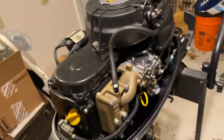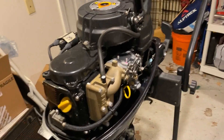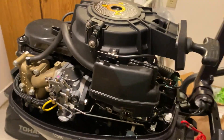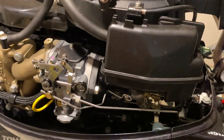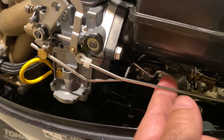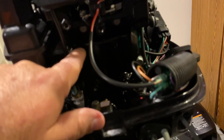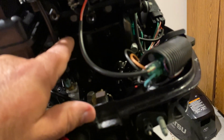Let me show you what I did. I was a little tentative about this because while I'm willing to do any work that requires very low skill, I'm not really a wrench turner and don't have a lot of skill when it comes to working on engines. But it turns out this is a surprisingly easy swap — literally two or three bolts and the carburetor comes off. First, you have a choke linkage and a throttle linkage. Both of these you can see have a set screw, and this one just goes on with a clip. Then there are two screws in the back, and you need a socket wrench with an extension on it.